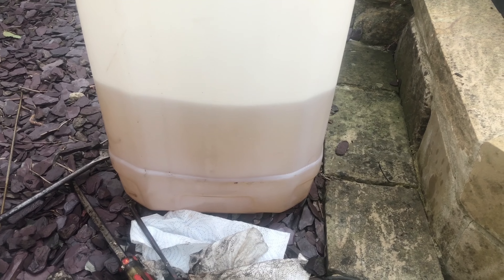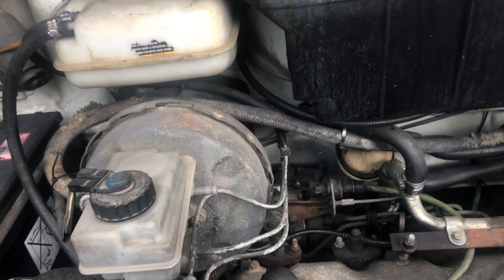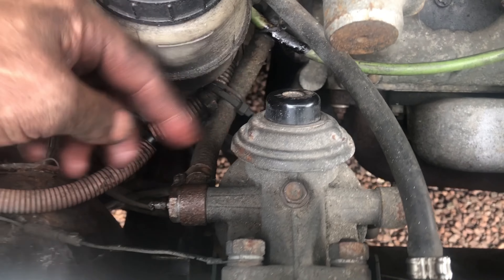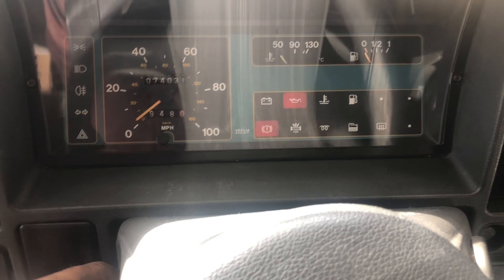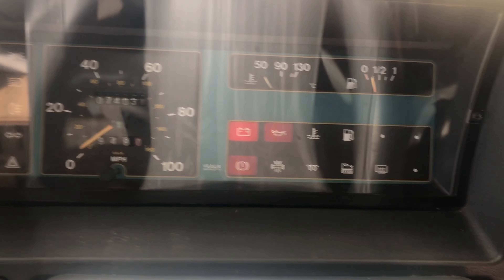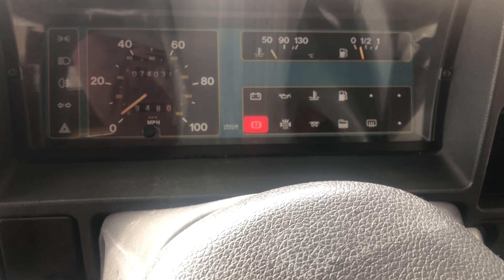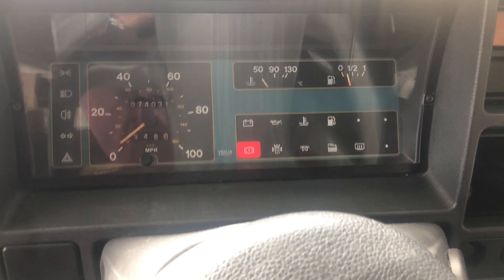So it's probably a good gallon or so that it can't get as the last gallon. We've got some dieseling! If we do have to reprime it, just crack that nut and get some diesel coming out. But I'm going to stick my neck out and say I think it will prime itself. OK, we'll give it a start. You can see the fuel gauge has moved and we've put a bit more diesel in than what we had — and we're on it! Hopefully that should draw the rest of the diesel through. Many thanks for watching, and why not subscribe to learn more low cost repair solutions.